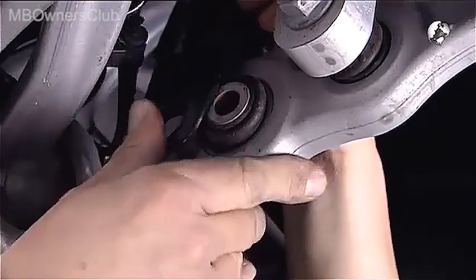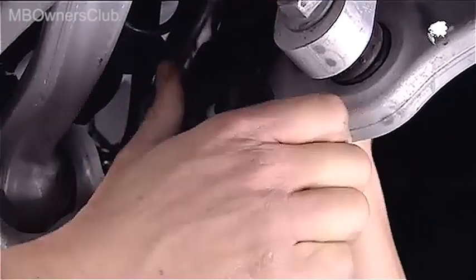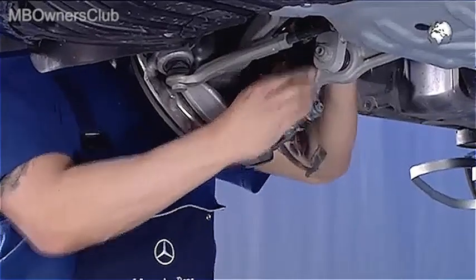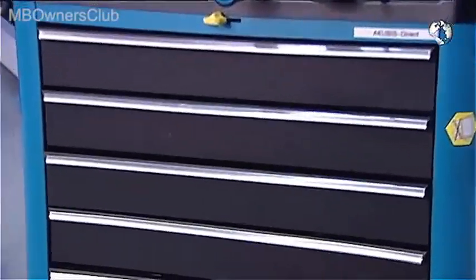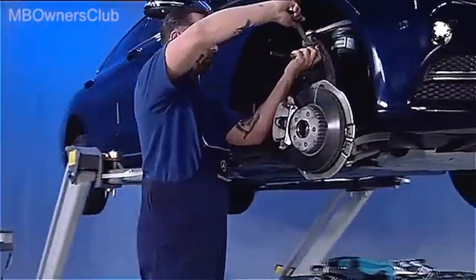If you install a new shock absorber, you need to measure its length and also refer to the leaflet in the package. Also check the condition on the shock absorber joint on the spring control arm. Conclude with a headlight adjustment and also check the shock absorber and the high pressure line for leaks. The remaining installation is in the reverse order.